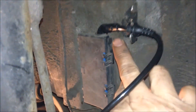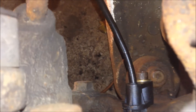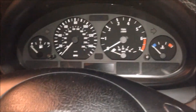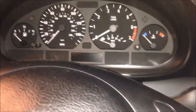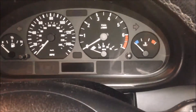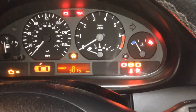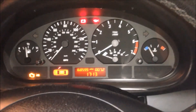Put the cover on, clip it in here and on this side, from the clip over there and to the bottom. We have the sensor installed and the bolt tightened to eight newton meters. The ABS warning lights automatically disappeared after about 10 meters of driving. So if you switch the ignition on, the lights are gone. Good job done.